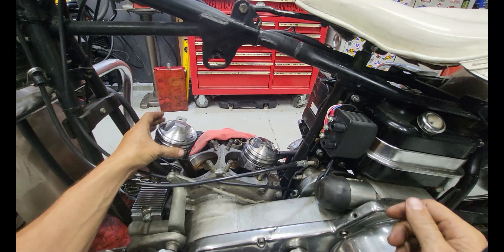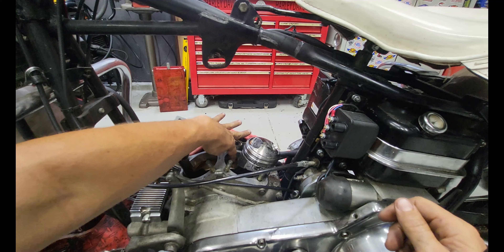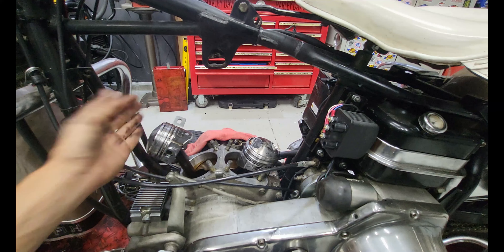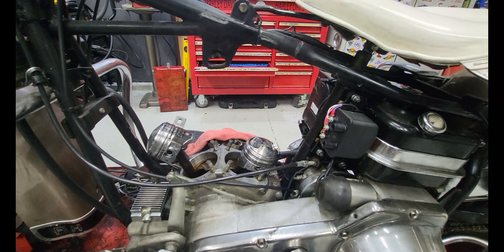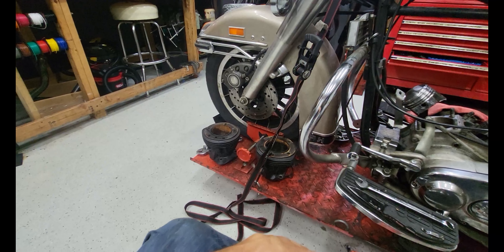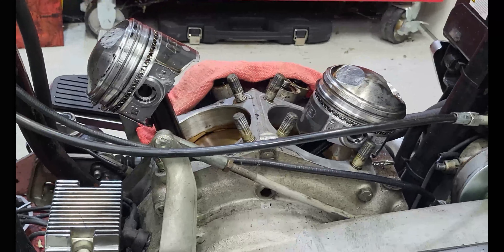Everything else looks pretty all right. I know these rings are gapped. Need to get this crud wiped off before it falls down in there. Well, I think that's about as far as we're going to get tonight, because I ordered some snap gauges so I can measure the bore on these cylinders - that's really the next step. Can't do much until then. Somewhere I've got a tool that slides in here and holds these things up - it's red plastic and it's cool - but I put it somewhere I wouldn't forget it. Next video we're going to be checking bore and trueness on these old girls to see if they need shipped out or not. Stay tuned.